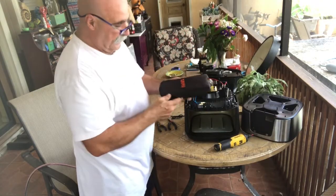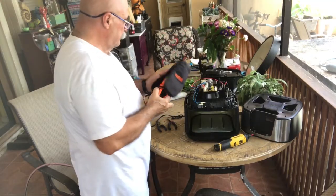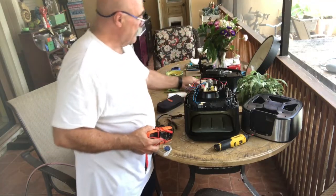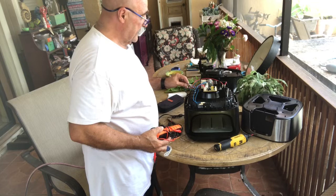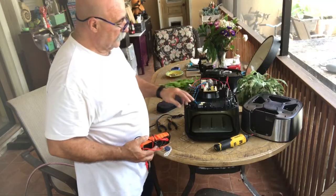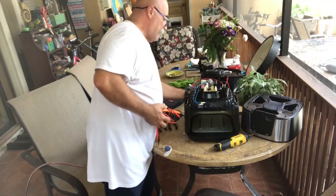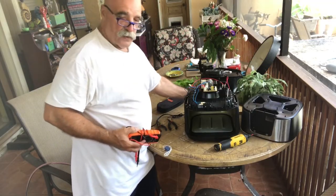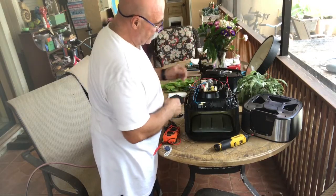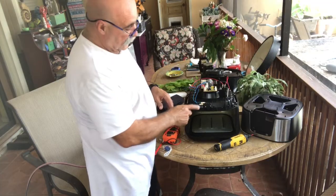What I had already done — and I'm going to show you — I pulled out here and found the two wires coming in. You have your red and your blue. When I ran my tester, I found that my cord is fine because I had 120 volts on the cord. Then I came up here and tracked it — everything seemed to have continuity except for this switch. The switch didn't have continuity.